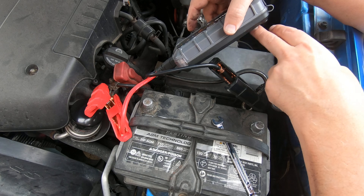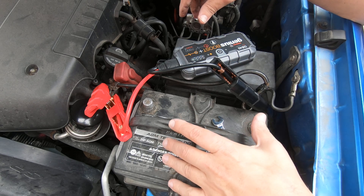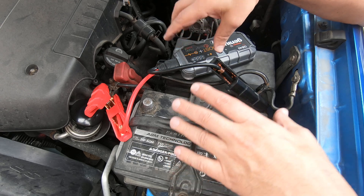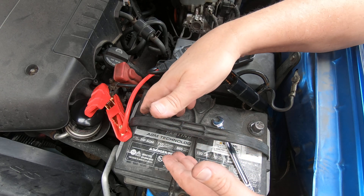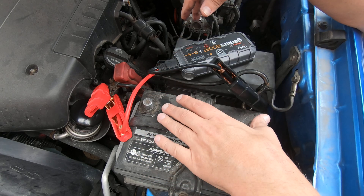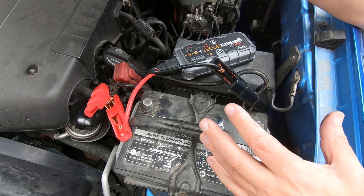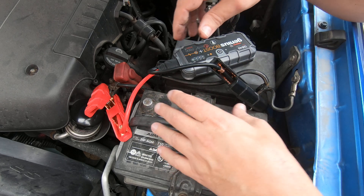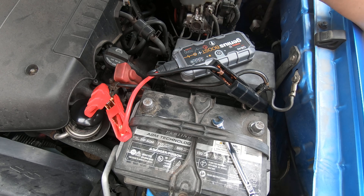It's actually kind of impressive to me that this is able to crank the engine at all, since the battery is puffed and it's eight years old and it's literally been in my truck through summer and winter. Normally if you've just got a battery that's dead and it clicks, the battery is providing some power. When you hook your jump pack to the battery cables with the main battery still connected, you're just providing extra help. If this battery was just weak but still connected, I have no doubt this would have provided plenty of boost to help the main battery crank the engine over and start the vehicle.